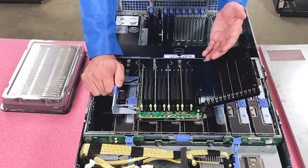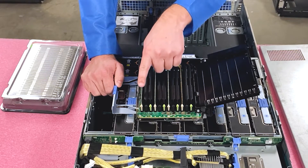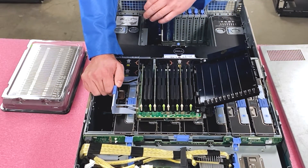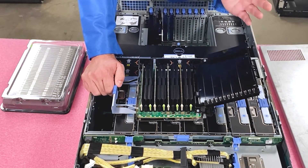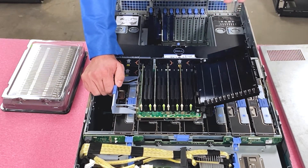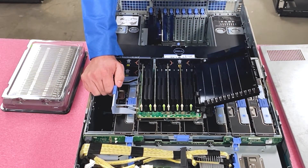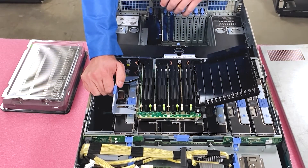With load-reduced memory, it's a better technology. What it does is allow you to break the rank rule, so you can load literally all slots. Even 64-gigabyte or eight-rank modules — it just doesn't even matter; you can load the whole thing all the way up. You can put in 12 by 64 gigabytes per riser, which is pretty awesome. If you're going to have a machine like this, you should max it out. You should put the extra RAM in because you're using an intense application, and the RAM is really what's going to help you get that extra performance.